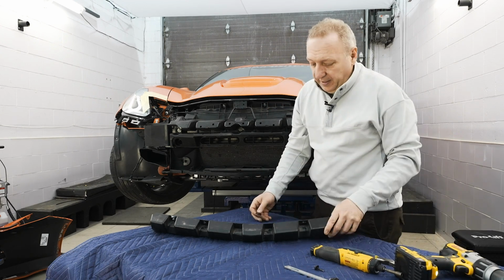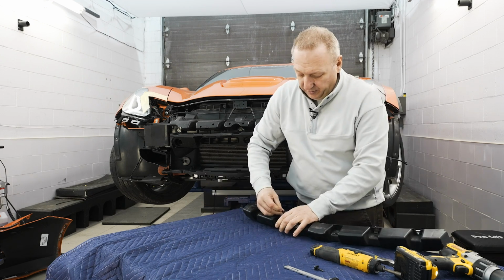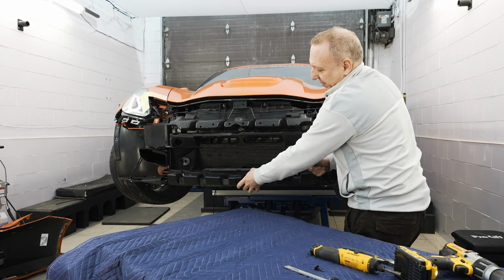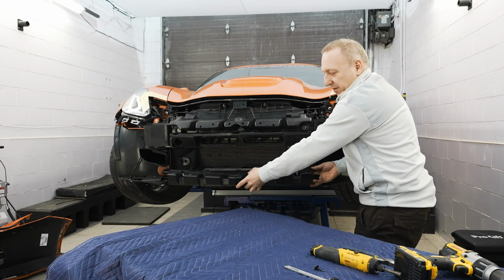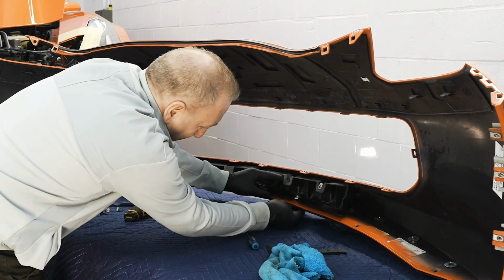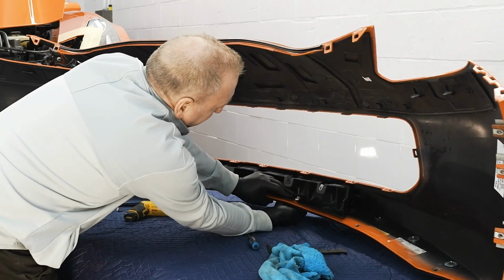There we have it. Now my reinforcement, I could go ahead and install my U-nuts, keeping the flat side of the panel with the flat flange or the rear of my reinforcement. What's going to happen is when the whole bumper assembly goes back in, we could go in the back, put our 7mm screws and fasten it and get a really tight seal between the grill and the radiator shroud. Once this is done, I'm going to put a 7mm bolt just so it doesn't fall off or play tricks on me as we're working.